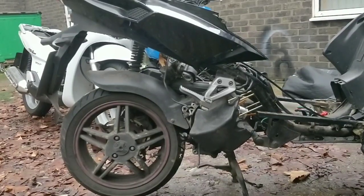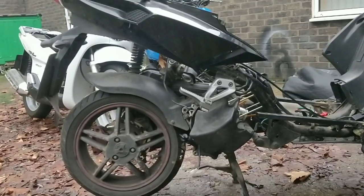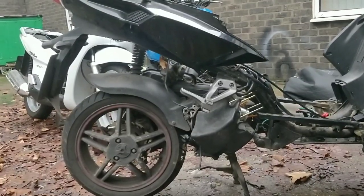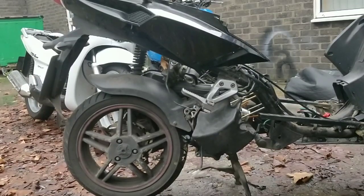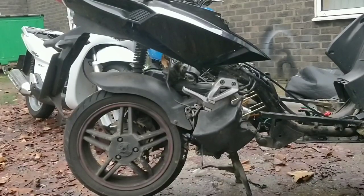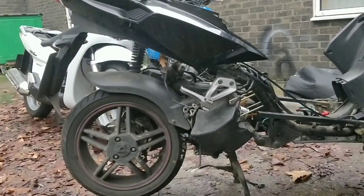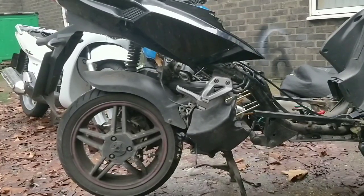That bit's easy. For now, though, scrape off the old gaskets, put on the new gaskets and start reassembling. Get it torqued down, make sure the plastic cover goes around it. Once it's all torqued and back together and you're looking at the valves, then you're one step in the right direction.